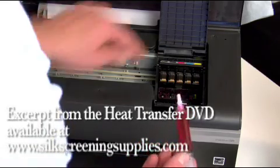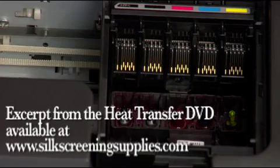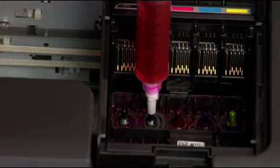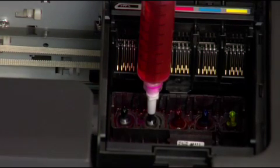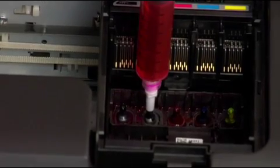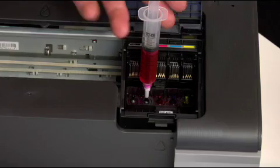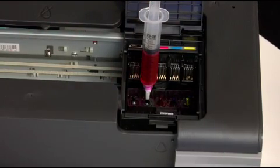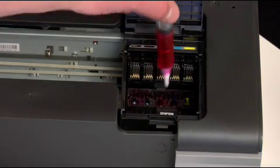We're having problems with our Number 2 Black and our Magenta. Take the syringe and fit it over the nozzle of the Number 2 Black — it will fit snugly and even sit in place by itself. Push through just a tiny bit of solution. Ensure that solution is entering through the print head and is not spilling out, because spilling can ruin your print head and printer.